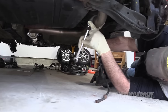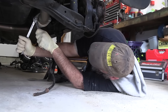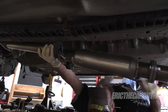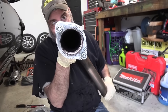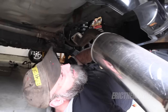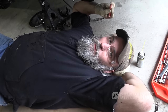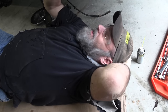I'm going to try to remove the muffler first — if I remove the exhaust now, that's one less component in the way, and it opens things up for the next step, which is going to be the fuel tank. I'm removing the fuel tank. Also, the fuel filler neck on this vehicle is pretty disgusting, but I got a brand new one. It's not a Honda part — I couldn't find one. So first I need to remove the cover from it and then try to disconnect it from the fuel tank.